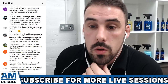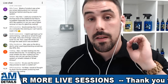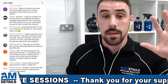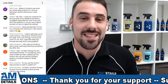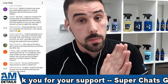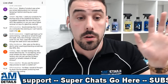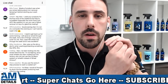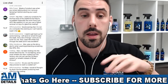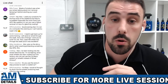Lower Up Lip from Highland says: I've just bought a white car with lots of orange spots all over it - how do I remove it? I'm going to guess that's iron fallout, so you want to be using AM Iron. Go through the five-step safe wash technique first so your bodywork is nice and clean and safe, ready for an iron fallout removal. I personally do a tar session next, generally because tar is larger and easier to remove from paintwork - if you put iron remover on and then start wiping, you might pick up some clumps of tar on the microfiber. So: five-step wash technique, tar session, then go on to do your AM Iron session - that will help you remove that orange spot problem.